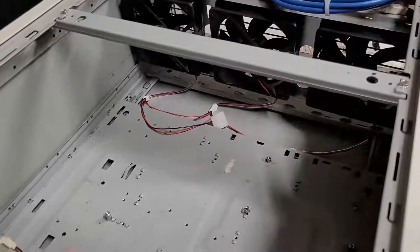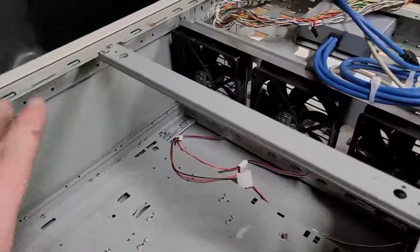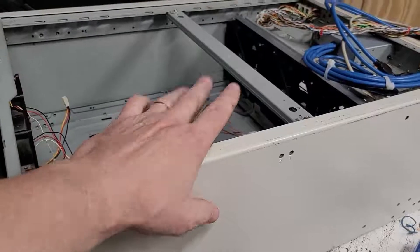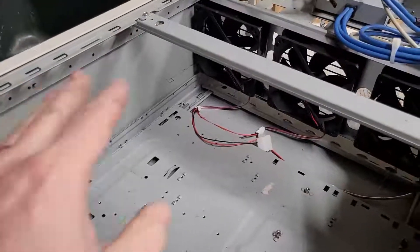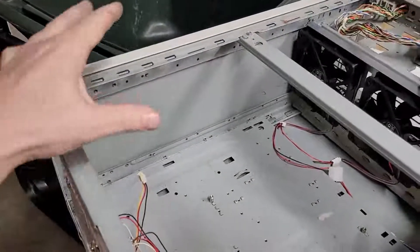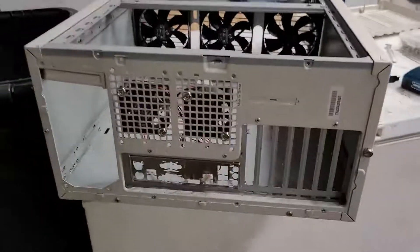My goal is to keep it around 68 to 72 degrees Celsius — that's okay and that's normal. It can obviously be better and it definitely can be much worse. This chassis actually has an insulation coating on it, which is the tan coating side, and it's been very valuable for non-IT enclosure environments because of the nature of home labs. Another thing I like about this chassis is its extra support in the middle, because a lot of times your whole chassis will bow due to the pressure of weight variances caused in the corners. So with this, I've got the chassis pretty much ready to receive a motherboard.